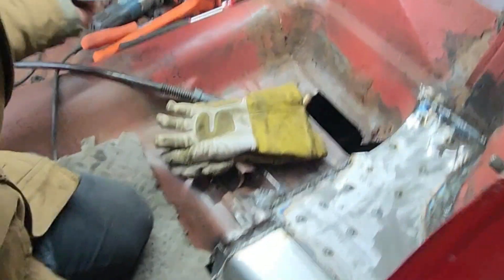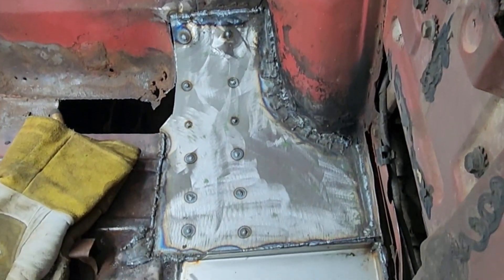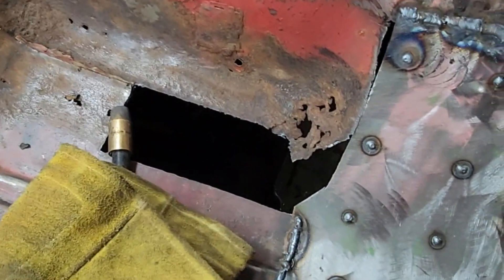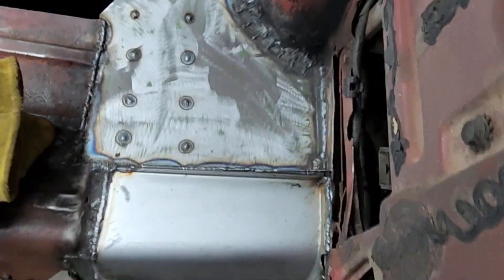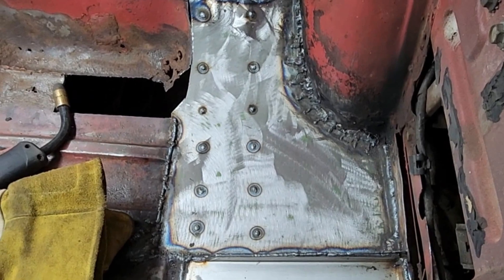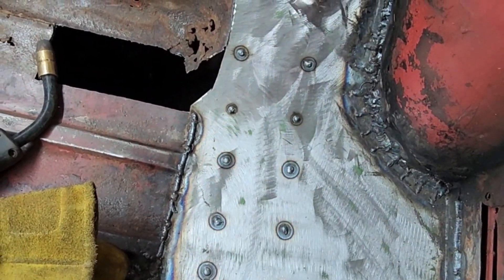Let's see how T did. That looks good — it's real solid. So now we just have to finish that hole right there. Any time you're welding this type of stuff, always drill your holes on top when you're doing spot welds. These are the spot welds to the frame rail, and you weld it from the top because gravity goes down, so it'll hold better.